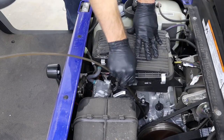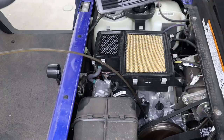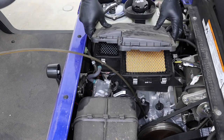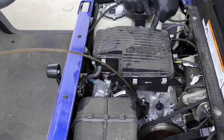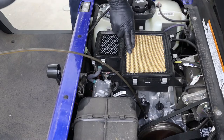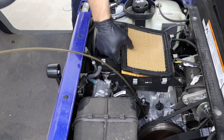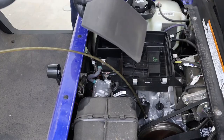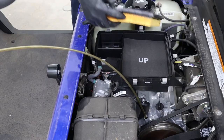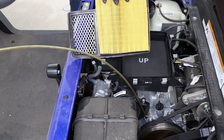Next we're going to take a look at the air filter. On these newer Drive 2s the air filter lid has clips all the way around that hold it down. On the older Drive 1s there are tabs on the side of the air box with holes in the lid, so when you reinstall it you hook one side and then clip it on. The air filters are different between the Drive 1s and Drive 2s, so make sure you get the right one for your machine. You can pull the filters up and out, and there's a foam pre-filter underneath that you can wash with dish soap, let it dry really well, and reinstall dry. Air filters typically last a couple of years — just blow it off if it's really dirty.